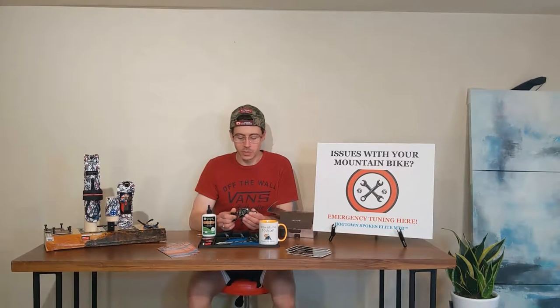There's no substitute for testing stuff in the wild and actually seeing it before you recommend it to a customer. Just being able to hold and touch this shifter and talk about its features was well worth the investment. So our proposition: we're going to explore a hybrid drivetrain with my permanent hybrid fixture — my Sunrace 11-to-50 11-speed cassette — introducing two new variables: the new M9100 XTR shifter with the mode converter, and radically trying to put a SRAM GX Eagle 12-speed derailleur on that drivetrain. If it works, we'll have the ultimate Franken-train.